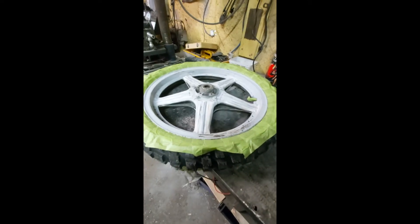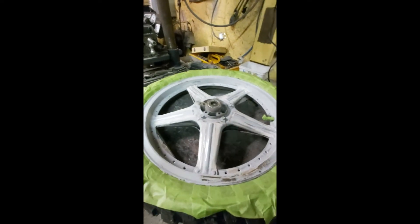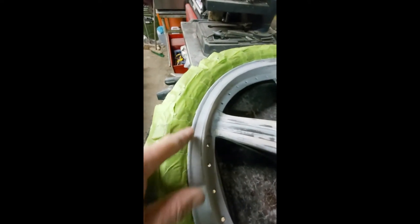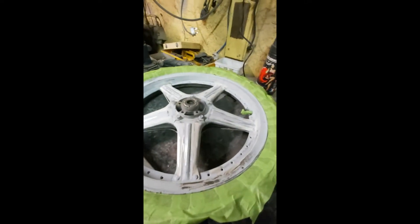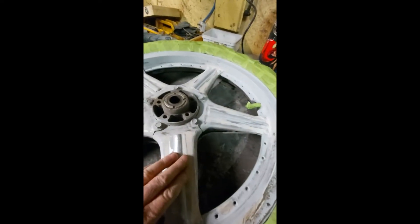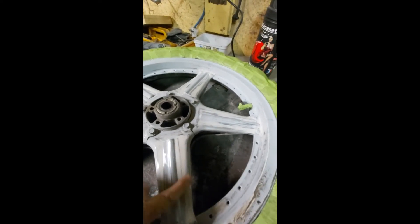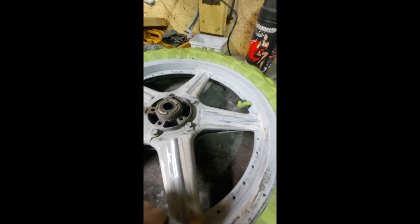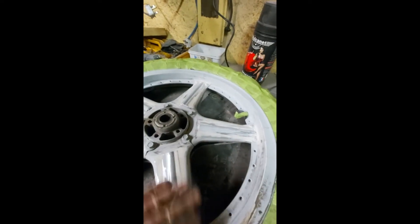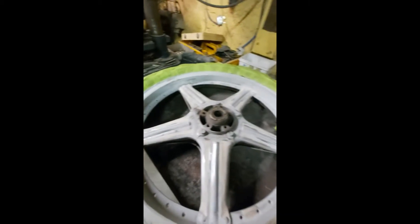The tire is on the wheel already — the reason being I was worried that finishing the painting first and then putting it on the tire machine would chip the paint. As you can see around the edges where I primed it yesterday, some paint did come off, so I'm glad I did it that way. For the panel filling, I filled the edges just to take them off but didn't finish the fillers completely — there are dents, humps, and hollows. When it's painted in two colors, one color will sit in the hollows and another on the raised areas, and when rubbed back it'll blend nicely.